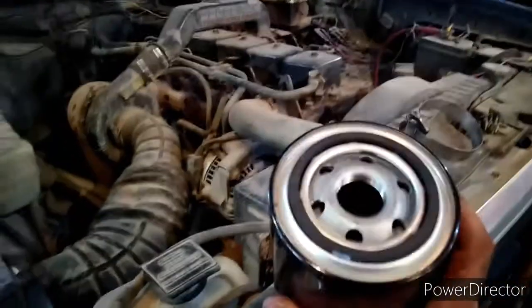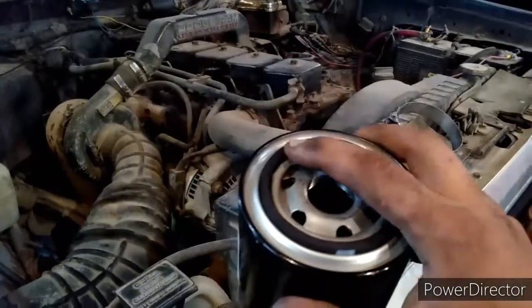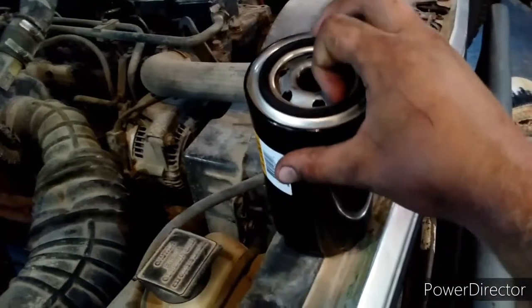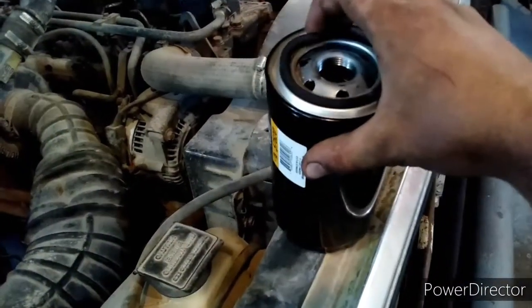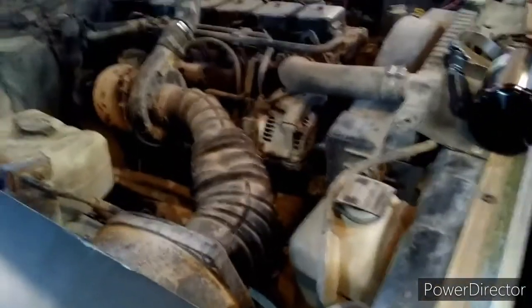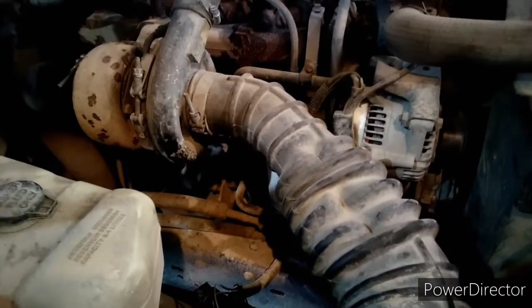Also, after I put this on, and you guys aren't going to be able to see me actually put it on because unfortunately I have to have both hands for that, but always take some of your old oil and rub right around this rubber gasket and rub right in here by your threads. It makes it a lot easier to get your old filter off when you go to change it, and also keeps that seal from sticking up in there, because as you guys can see, that rubber seal does come out of there if I peel it out with my fingers. You don't want it sticking up in the filter head. So always make sure to put old oil or just any kind of lubricant on that. I use old oil because it's what I've got around, but that ought to keep you lubed up for the next time, so it's easy extraction.